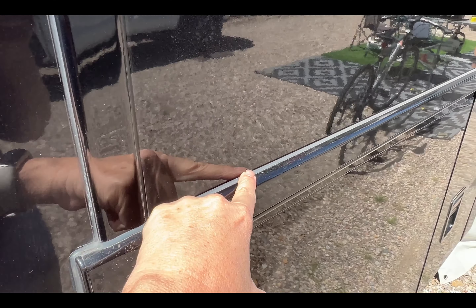If there are any cracks and holes you want to make sure you're repairing that sealant. There's a whole method on how to do that yourself. You need to make sure that you're cleaning it first and then repairing it with the proper sealant type, because there are different types depending on what roof you have. You never want to just keep re-coating the sealant — after the second patch-up, tear off that old sealant and replace all of it. And it's not just for the roof — make sure you're doing it for the sidewalls as well, around accessory panels, cargo doors, refrigerator vents, and things like that.